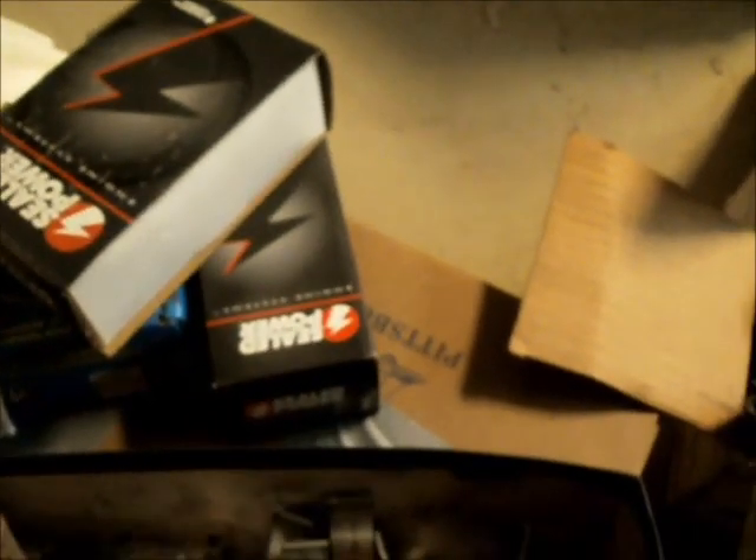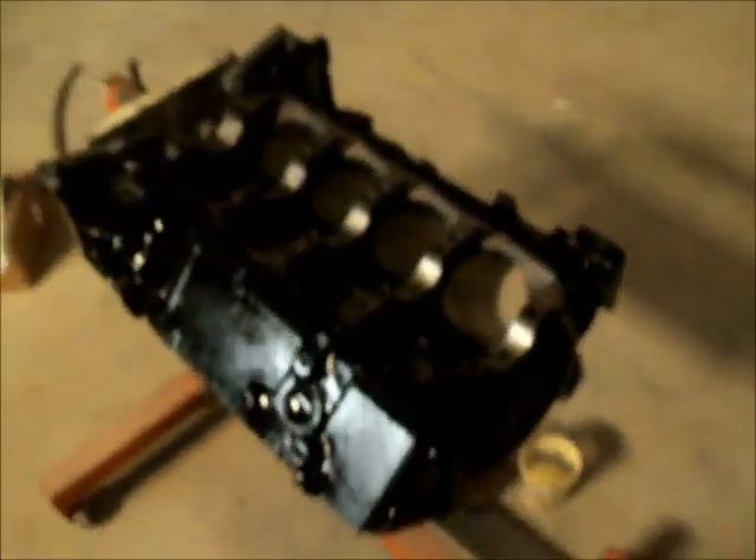Hey guys, we're back. Let's put some light on this. Blueprint motor, small block 396. As I stated earlier, I pulled some of the main bearings and they looked good — until I pulled them all and found some shit going on. The cap side doesn't look right; the block side looked alright. Now, this motor had aftermarket caps because it was a two-bolt that was converted. The bores are usable but a little out of whack because it wasn't done on the deck plate.